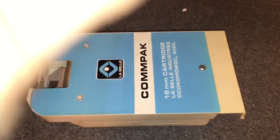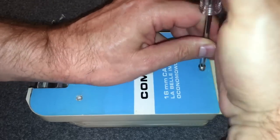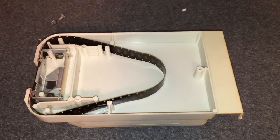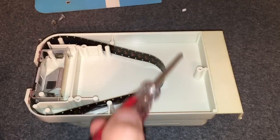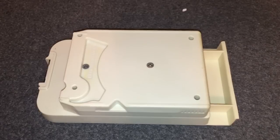Now, most of you probably have seen the inside of an 8-track tape. So you probably think, well, the film is on an 8-track loop, right? On a reel. Well, in this case, no. The film is literally just in a loop on the inside. Now, if they have more film, the loop is just looping around all inside of here, and it just goes around in one big circle and goes on through. So there really aren't enough frames in there to warrant having a reel that it would loop in and out on. On the tape side, once again, they made it really easy for us to get into.